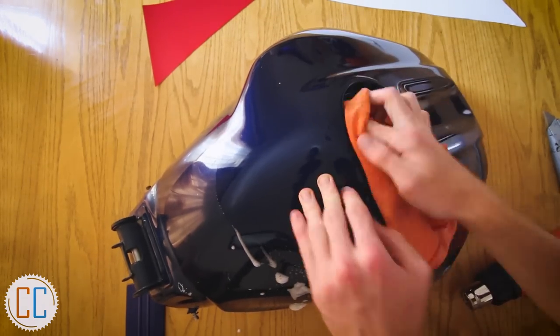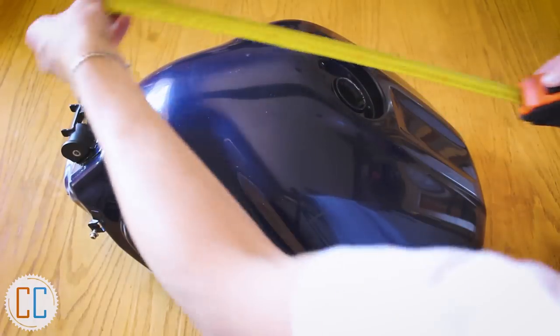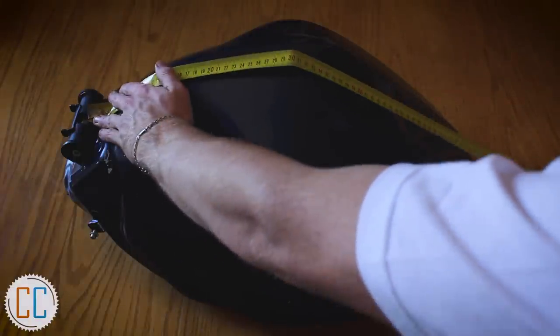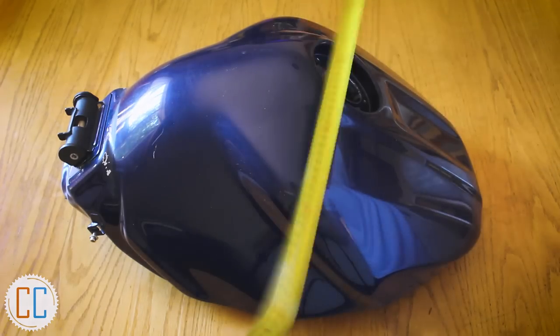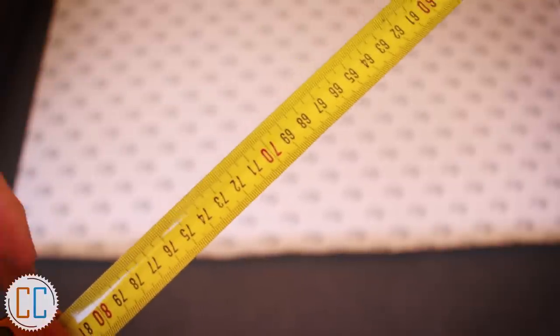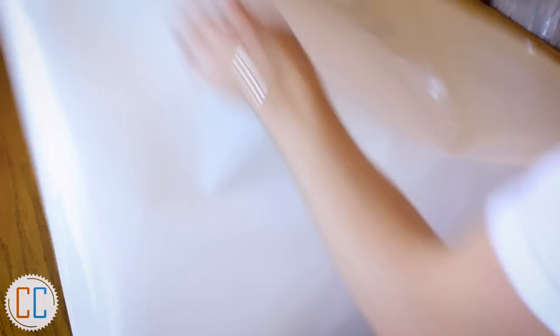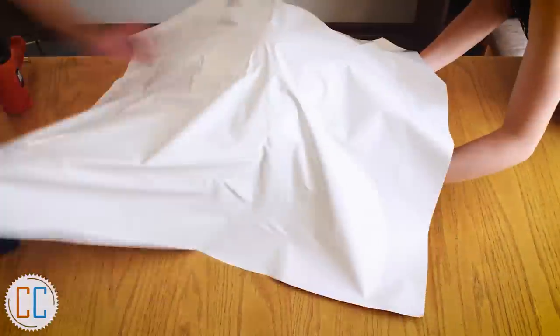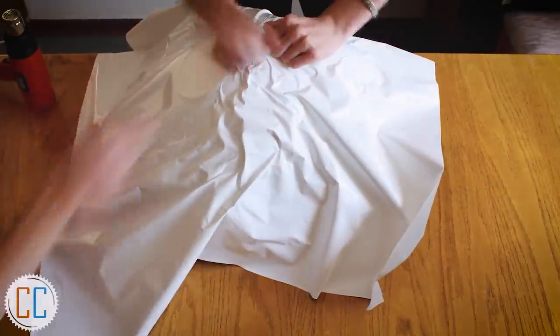The wrap prep is our last step before we're going to actually wrap it. Once the tank is clean we can start to decide how much vinyl we actually need — we're going to measure it out. From here to the edge is 75 centimeters and around that way it's about 80 centimeters, but I'm going to leave 10 centimeters on each side for error, taking into account the edges and the dips. This is going to be the single piece we attempt to wrap the tank in.